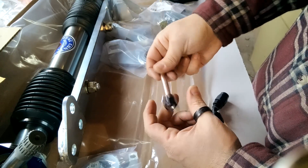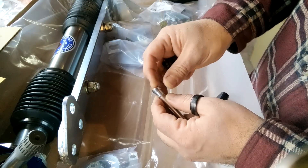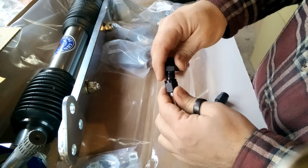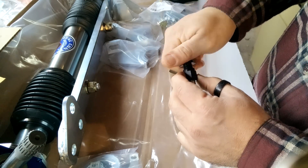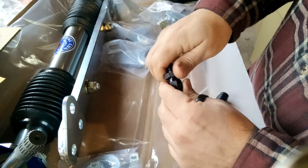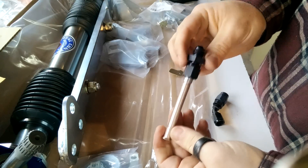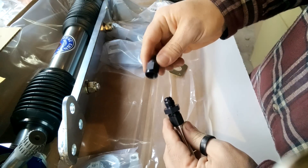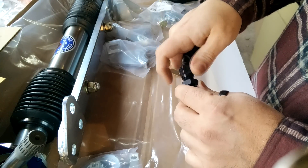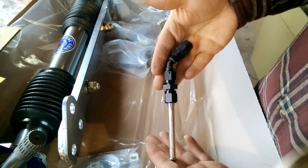It mates very nicely together. What the sleeve does is give that strength and provide a collar for the nut to hold onto. The line slips right in, the nut screws down, and now that's all put together. You can crank this down and your hard line is ready to mate with any flexible line. This is just a bare end with no hose assembled — they would simply mate together and you're done. Thanks for watching.